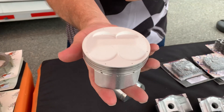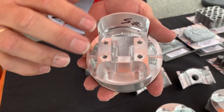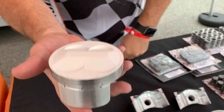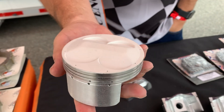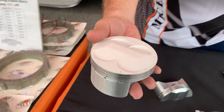You don't lose any durability by taking that material off? We do test and we work with engine builders - as we thin them out we test with them. We've been working with George Babord on a four-valve naturally aspirated build. This piston here is amazing - we lightened the inside, took a bunch out, and George actually went and took more out of the side. This piston is now under 250 grams - super light - and that's what he's running this weekend with a naturally aspirated motor that's performing better than most of the nitrous motors.